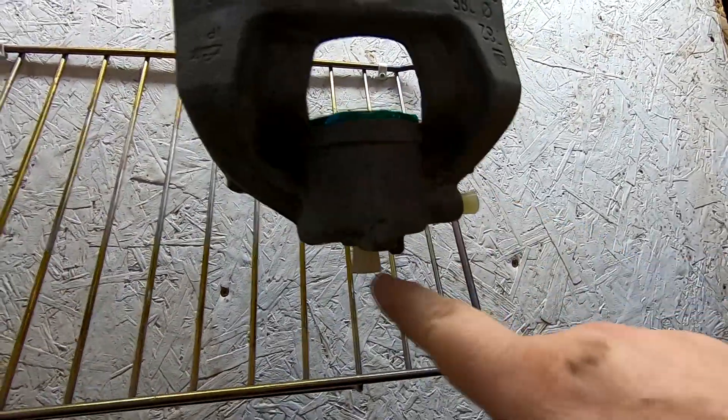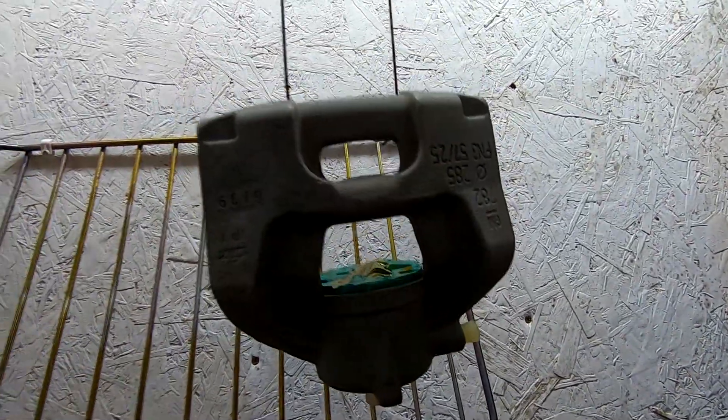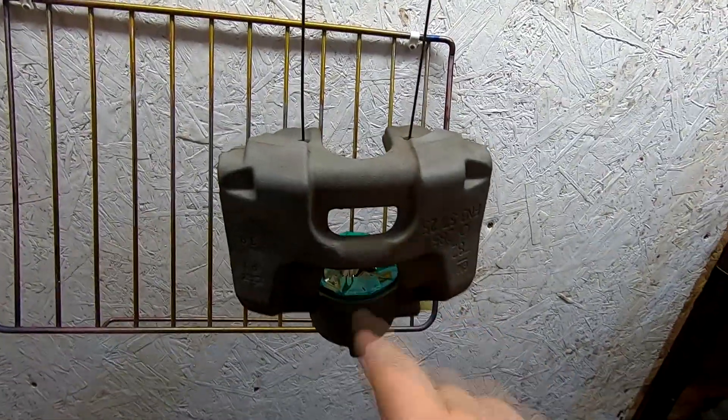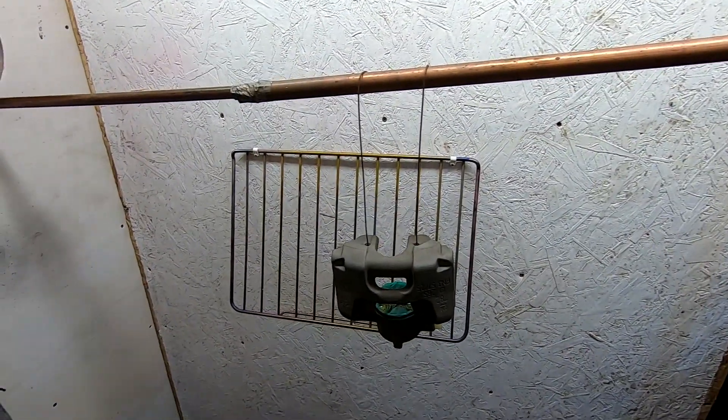You probably can't see them - it's a bit dark here where the threads are. Because you don't want to get any powder coat in the thread, otherwise you've got to start tapping out the threads and stuff like that. So I'm going to powder coat that. I've also taped up where the piston goes as well. This is only temporary at the moment - I've still got to sort out my hanging rounds for the powder coat. So let's get on and powder coat this and then we'll see where we go from there.